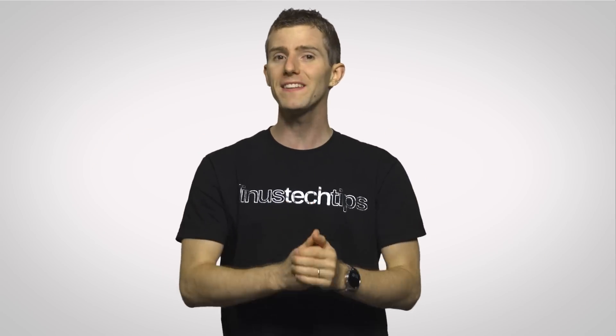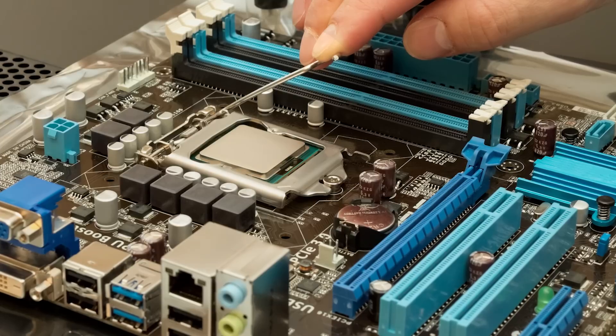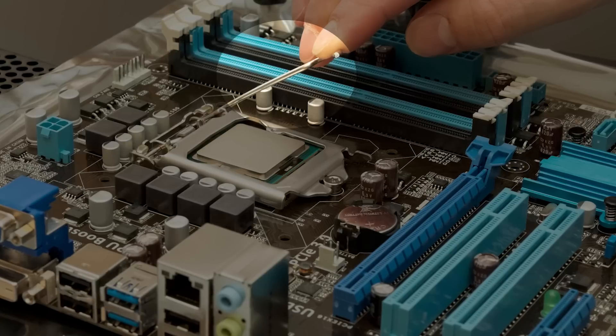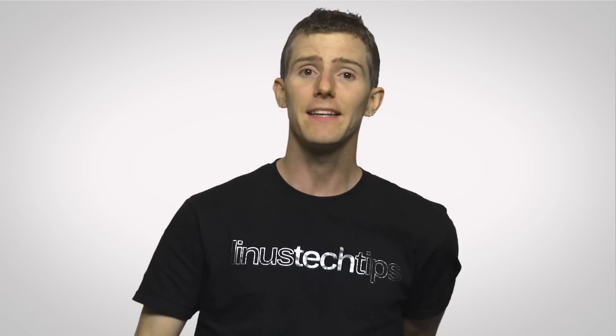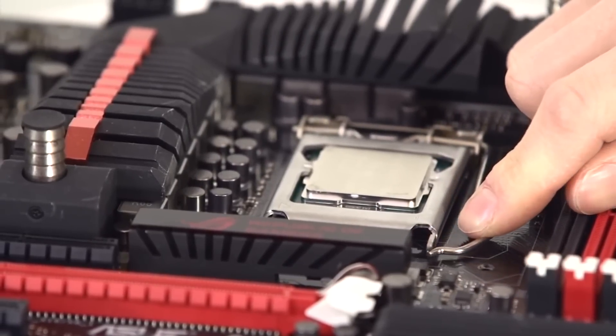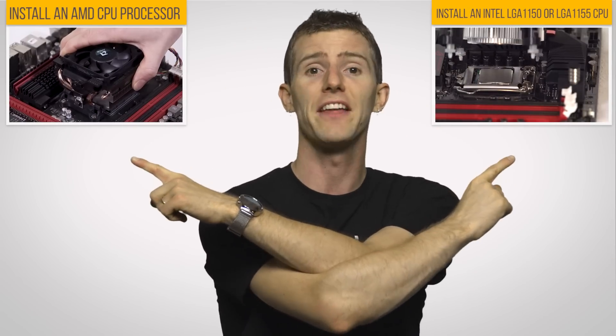But regardless of which side you're on in the CPU war, remember that both Intel and AMD chips do not require any direct pressure on the chip in order to be properly inserted. If you're pushing down on them, you're probably doing it wrong. Instead, modern CPUs are held in with retention arms. This is because the pins on the socket or the CPU are very fragile, and pushing down on the processor can easily damage your processor, the motherboard, or both, especially if they're misaligned. Instead, gently place your CPU into the socket and make sure it is properly aligned before putting down the retention arm. We actually have guides on how to do this in some of the earliest videos on TechQuickie, which you can check out here and here.